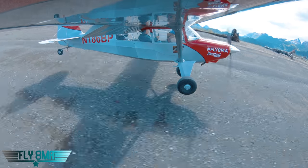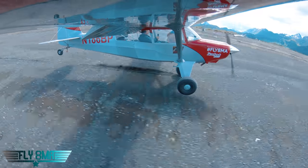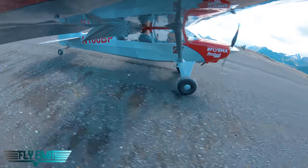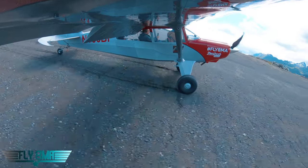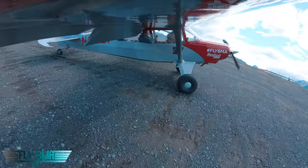That's an additional thing to think about. It's easier if you don't have to worry about it, and that's where we're at now with the bigger tail wheel. Now we're landing in these exact same spots that are nice and soft, and it's not really an issue at all. I can just pin that tail when we land, apply some brakes, hold that stick full back, and just get that airplane slowed down without worrying about ripping my tail off.